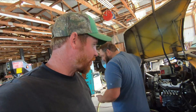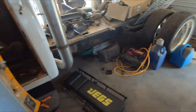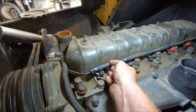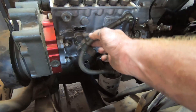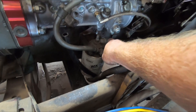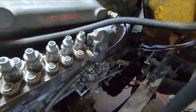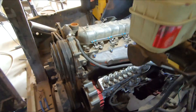Here's an update of where we're at. The other night we didn't get a whole lot done — mainly just drained the fuel out of the tank. Ryan put the injectors in and put the fuel lines on. As you can see, we have fuel lines hooked up — everything but here. This line comes from the pump, goes into the filter, then through the filter into the pump. We also have the manifold on — it was a really tight fit, literally just a perfect fit in there. Probably should have done a hair more shaving, but we got it in and it's not coming out.